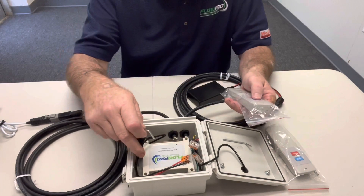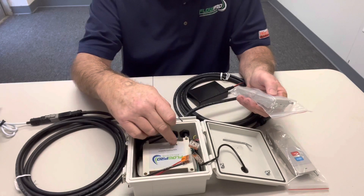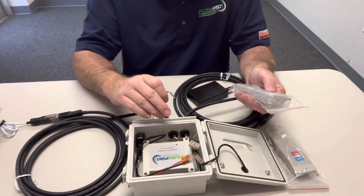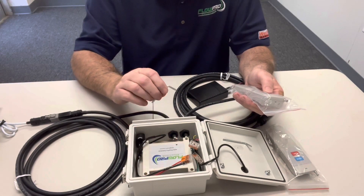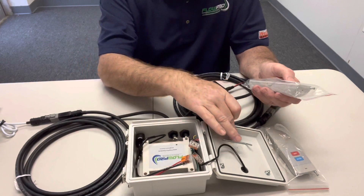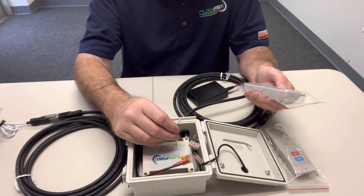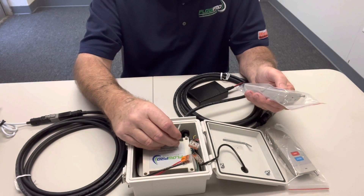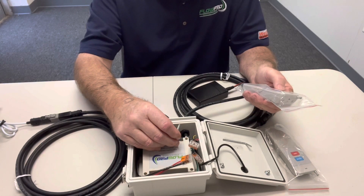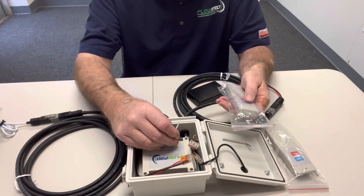So what we've done is inside the cover, inside the control box, we drilled a hole in the cover. There's a white reset button below that. All you have to do is take the Allen wrench that's supplied with the Flow Pro and just gently put it down into the hole — you'll feel it and hear it click when you push it. When you do that, a red light is going to come on, and when that happens, release and push the rinse button right after that.